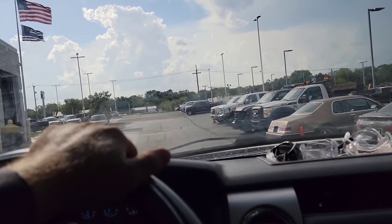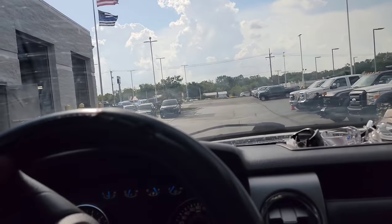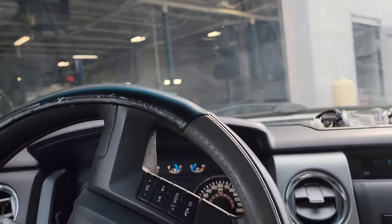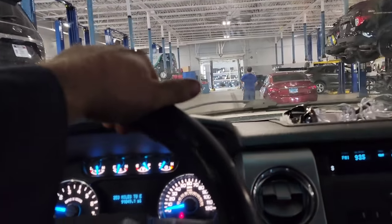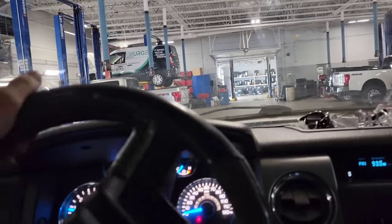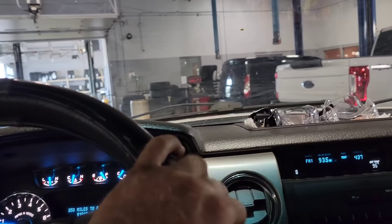And then we look at the bottom of the fuel tank and we see how the fuel tank's all sucked in like that. Well, there's probably some kind of issue with the purge valve, and as the engine's running, it's stuck open. It's constantly pulling vacuum on the fuel tank, and it starts to cave it in slowly. It's one of the issues that we had with Focuses and Fiestas with fuel tank deformation. The purge valves would have to be replaced, and then sometimes if it was bad enough, they say you have to replace the fuel tank as well.